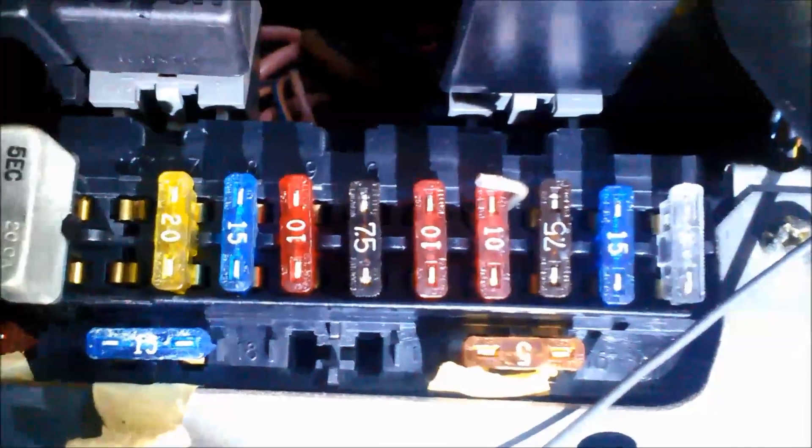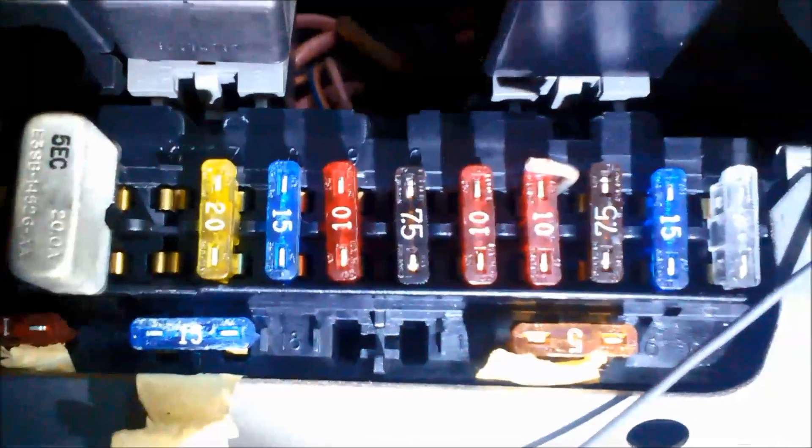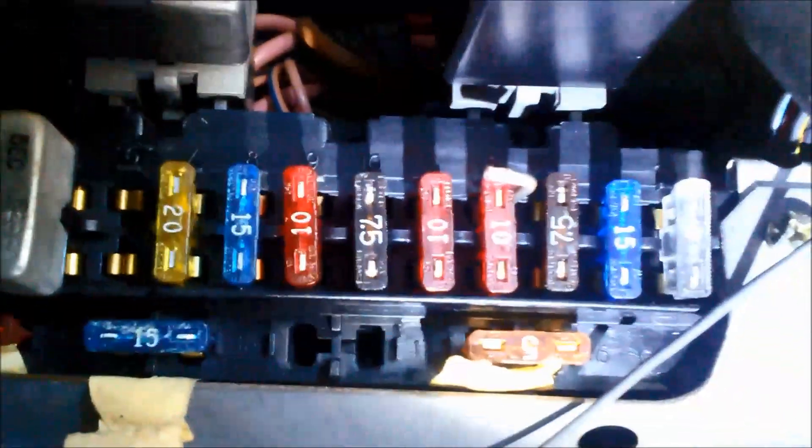Basically you can go around chasing all these things. It makes sense now that when we charged the battery up, it would have had a little bit more power and overcome the bad contact. There was only contact on the left-hand side though. As you can see, that little terminal — don't know where I've dropped it — it's broken right off. So that wire has taken up that little space where that broken terminal was.